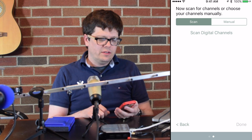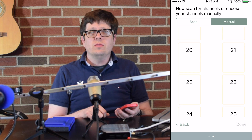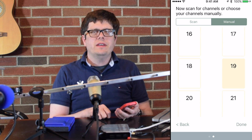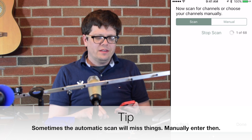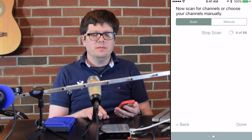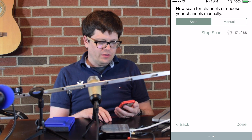Now I want to do an initial scan of my digital channels. There's a button here that says Scan Digital Channels, and there's also a manual option. If I happen to know that I only get three channels and they're the ones I'm interested in, I can manually type them in — I can say I know I get channel 19. But in general when onboarding, I tap Scan Digital Channels. It'll take a minute or two, and I'll skip ahead on the video to save time. In my area, we have no VHF channels, just UHF, so the first 13 channels won't find anything.